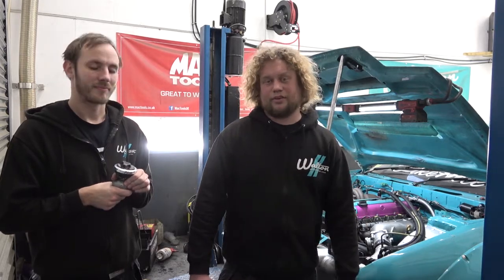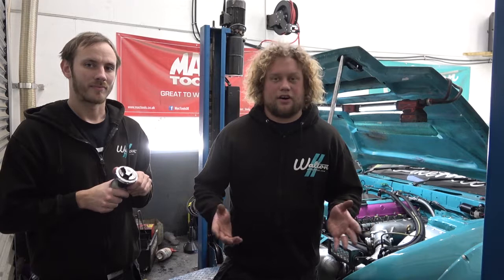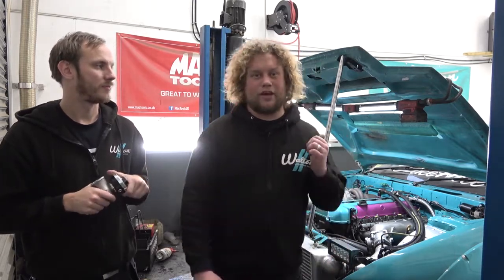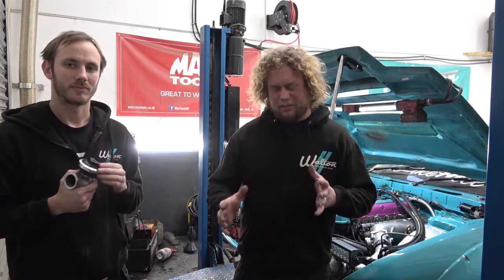It's a pretty old kit as far as motorsport is concerned, especially with the amount of use we put through it. We're going to change it for our most updated version — about a year old in design — which features extra wastegate priority. It also changes the turbo position very slightly, as we found that with massive turbos like the one we've got on there now, it's slightly too close to the head for our liking. The new one spaces it out slightly, which also allows us to get to an even larger turbo if needed.